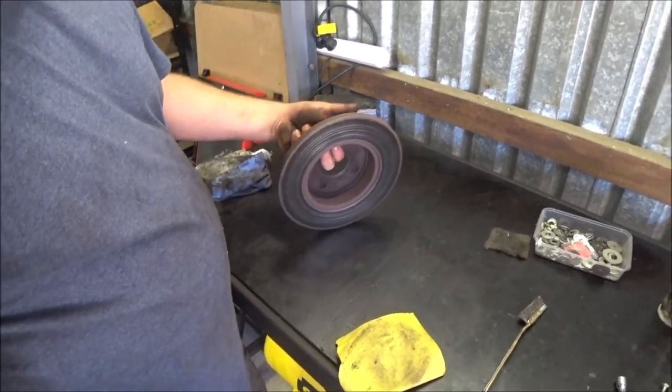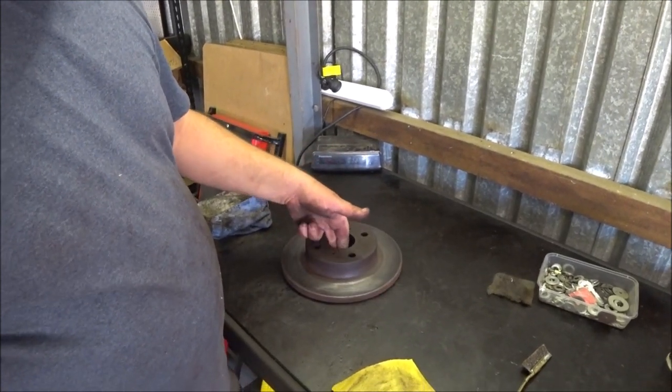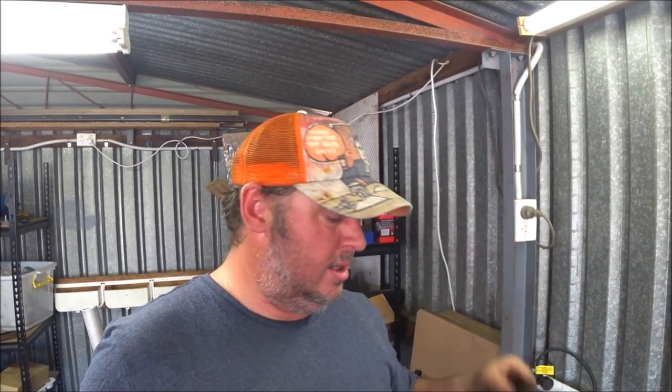This is not a new brake rotor, they're not new pads. The purpose of what I'm doing is to check for that woody feeling and see if that was the caliper binding. And it may have also been the glazing on the rotor, which just meant there was no bite, despite how much pedal pressure I put on. So if that fixes it up, this may only be a temporary solution. Maybe the new rotors go on and new pads go on at a later stage. But to test that now, this is how I'm going to clean these up, along with the scuffed pads, and give them a test, bed them in, and then drive it to work tomorrow and see how they feel.